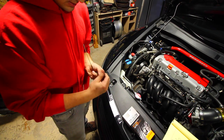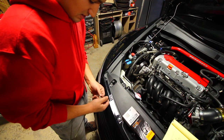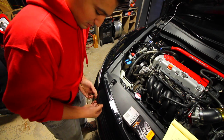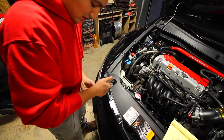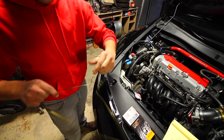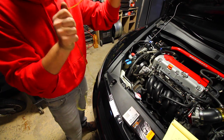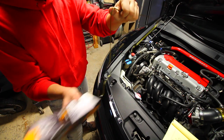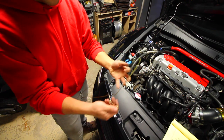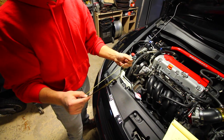If you undo this, you're essentially undoing the top. And then once you have that done, you're gonna have, okay, this is the hardest hanger I've ever seen. So once you have this undone, you're gonna have a little hook that you can play with, hook it down, fish that into the engine bay. Say you need to pick up the accessory belt, you can slide it over top of this and pull it up to give yourself a little bit more room. Now, if your hands can't fit down in there, this is a quick, easy trick to help you out if you get stuck.